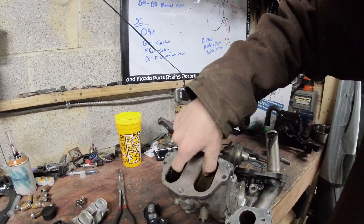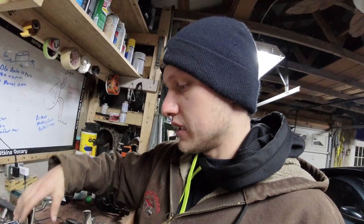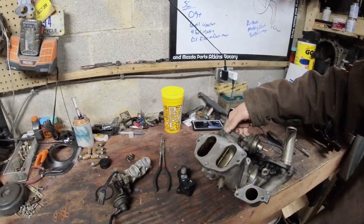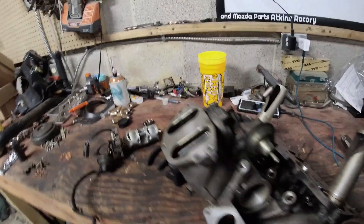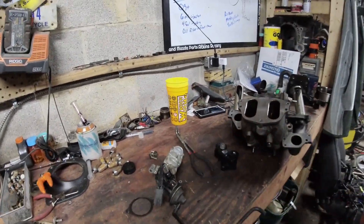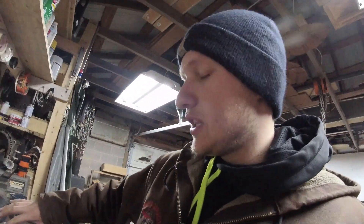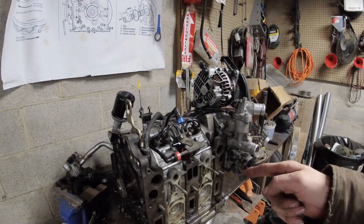These solenoids send air to the SSV and to the VDI. The VDI is the valve I mentioned in the other video — I never see them dirty because they're far enough away. At high RPM it provides a scavenging effect and a kind of supercharging effect from the opening and closing of the rotors. Make sure all these valves are functioning perfectly and not getting stuck. I got my overnight parts from Japan — it's now Tuesday since filming Sunday. This is a new lower intake manifold gasket from MasterTricks. Let's get to reassembly.